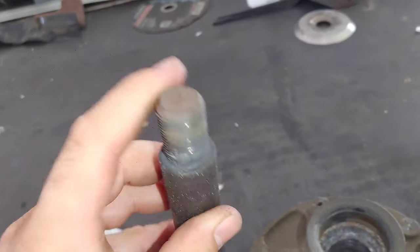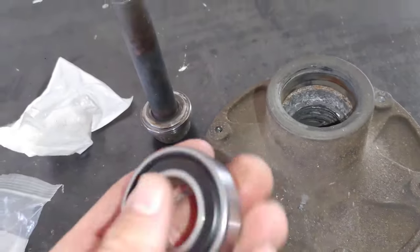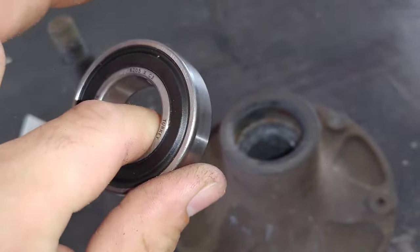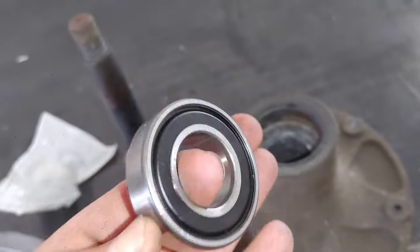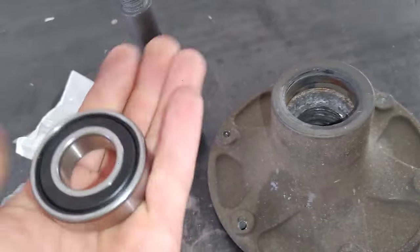So here's the shaft. There's no grease fitting at the top. These spindles actually come from the factory with these sealed bearings, and they last a long time when they come with true sealed bearings, in my opinion. It's a lot higher quality of a seal, and it probably has a lot higher quality bearing and grease inside of it. So like those John Deere AUC15811 spindles, they don't have very good seals in those bearings. So that's why I think you should grease them, fill up that cavity of that housing with the grease.